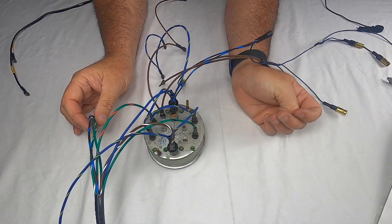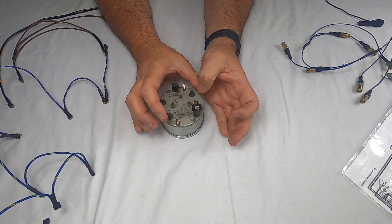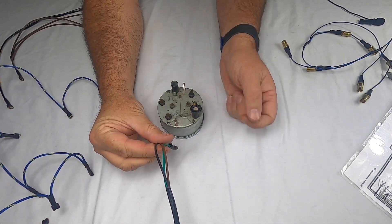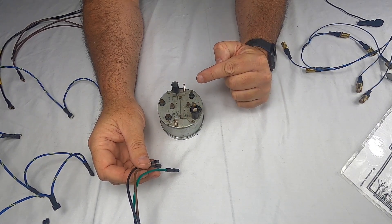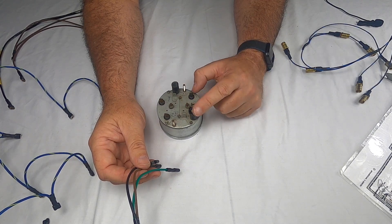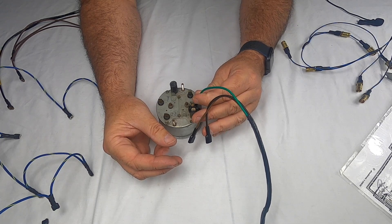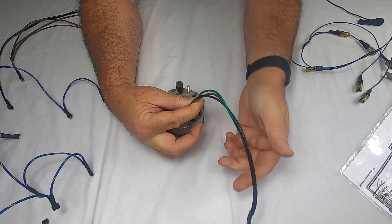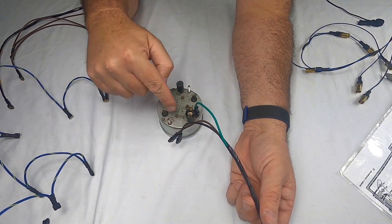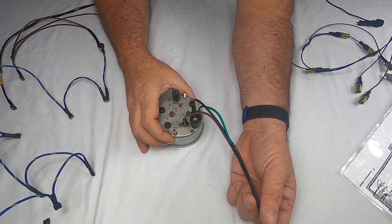Here's the fuel level and oil level gauge. On the gas tank side you've got a G, a positive, and a double bulb — the double bulb is your low fuel indicator that comes on when the gas gets low. The green wire goes to the G. Note that this harness comes from the front of the car via the fuel sending unit, not from the main fuse panel harness. The brown goes to the ground tab, and the black goes on one spade of the low fuel bulb.